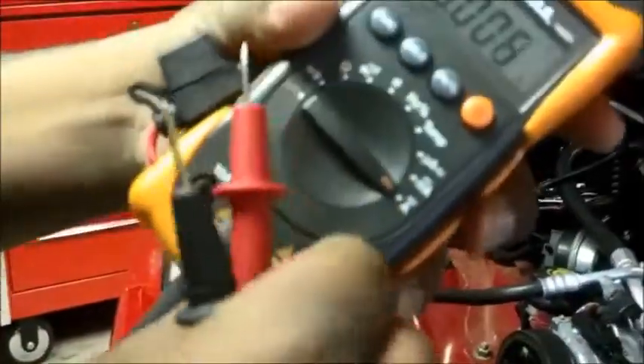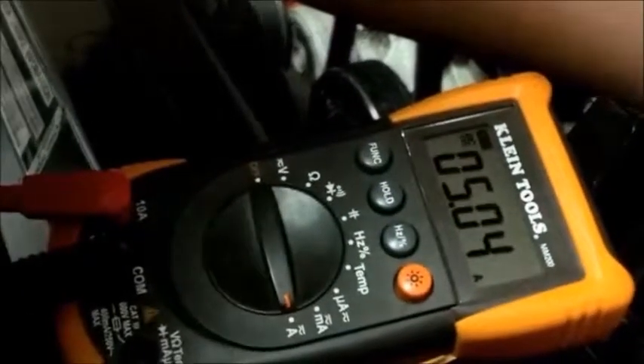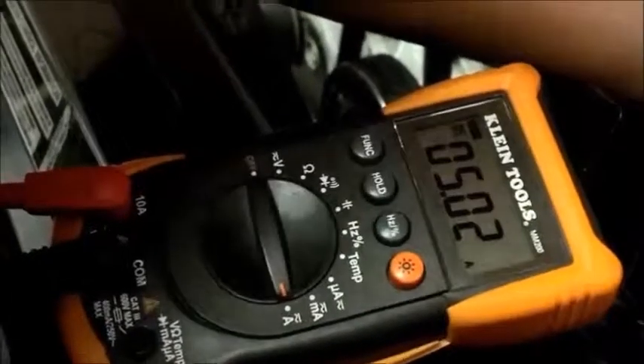Next, we're doing our amp test. We are going to take our multimeter and put it in the amperage setting. We're going to put the lead in the amp port so we don't damage the fuse. We're going to take our probe leads, put them in terminals 30 and 87, and test what the amperage is for the fuel pump. As you can see, it is 5.04, which is good because the specification is under 10 amps. By performing these tests, we verify that the fuel pump and the fuel pump circuit is operating correctly.